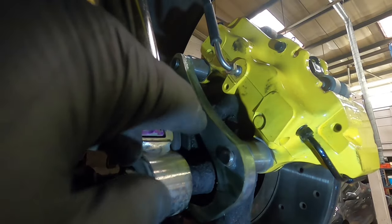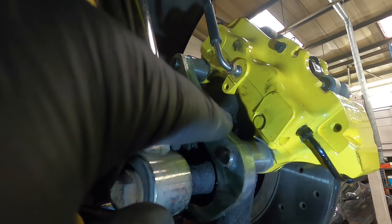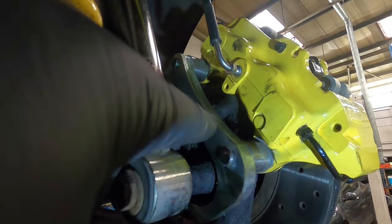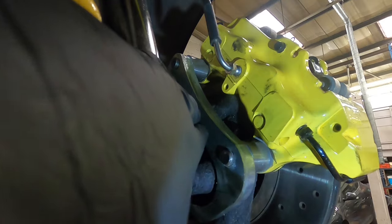After you've de-pinned the plug, then you want to plug it directly onto the ABS sensor. Now, the next bit depends on which way you want to do it. What I use, we have this epoxy two-part glue. I put a little bit in, not too much that I wouldn't be able to get it out, but enough that it'd hold it still. So basically, I slid the terminals onto each pin, like the plug would, but without the plug, so the wires are directly on there. The square that I'd cut out on the back side, I pushed the wires this way a bit so they weren't fouling.